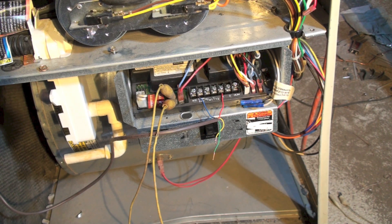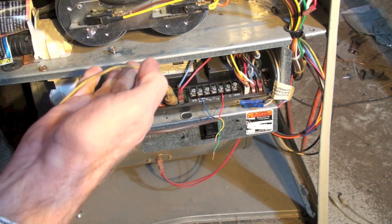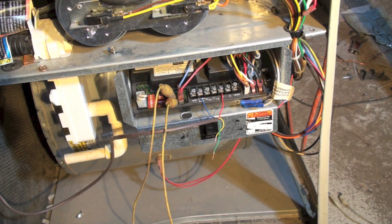I don't want to say this is a simple process — sometimes it can be kind of frustrating because it takes quite a while. Using the clamp meter and a jumper wire like I'm using here considerably reduces the amount of time you spend throwing fuses away, because that gets pretty frustrating. Be very methodical when you do this.